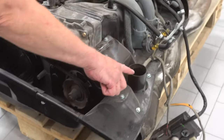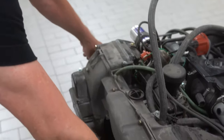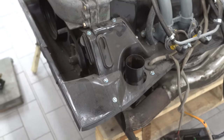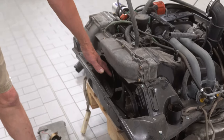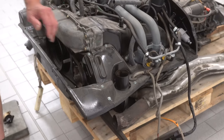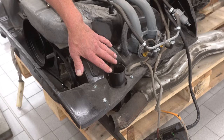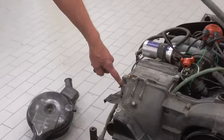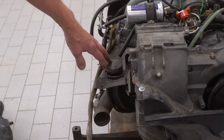Right here and right over here are called the J-pipes. This is where the auxiliary blower blows extra air into the heat exchangers to supplement the forward blow of heat when you're at an idle. Once you get going, the impeller is perfectly good enough to blow plenty of heat forward — but on idle, this is what supplements the heat. In 73, they changed the heater blower motor; they only had one hose here and on the other side they actually capped it off. It wasn't until early 75 that they reinstated both heater blower motor hoses.